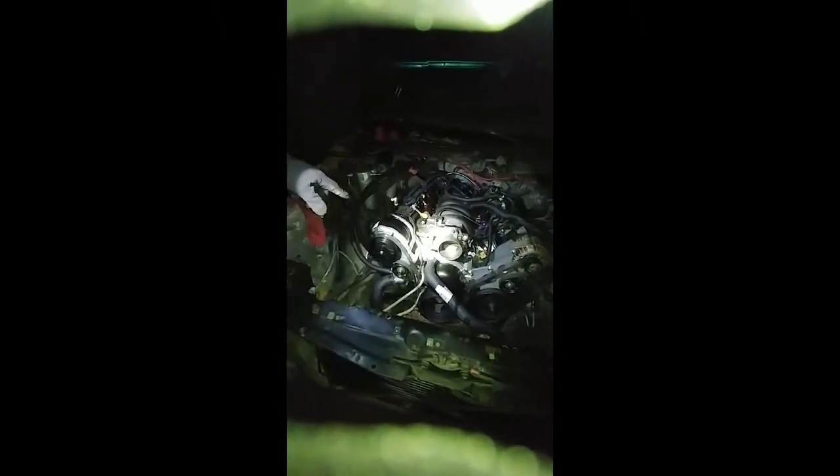As far as the water pump, we use the Camaro water pump on here. So we went with the 98 to 02 model year, and it has a spacer behind it so it can push it out and line up with the truck harmonic balancer on this. That was really important, we had to do that. Get a shot of those spacers.